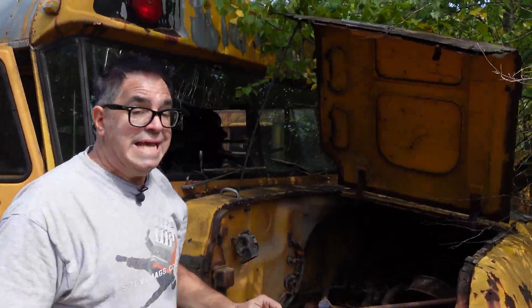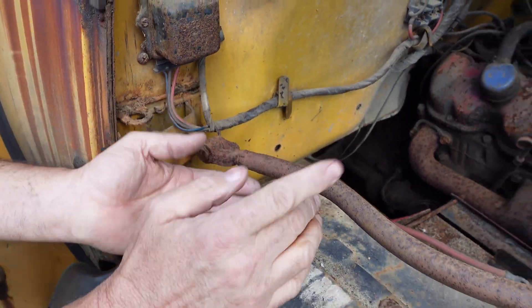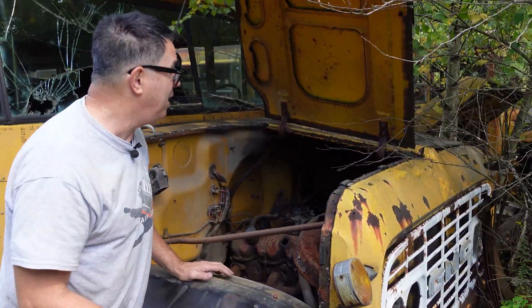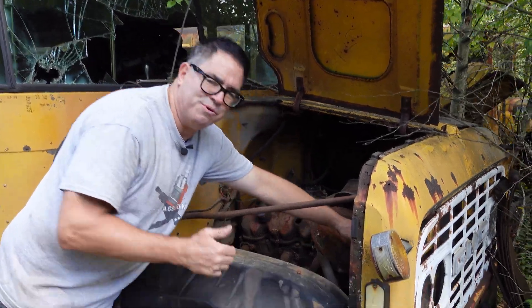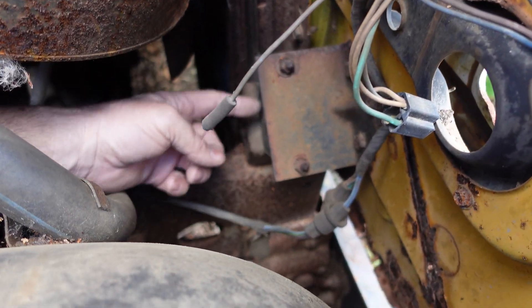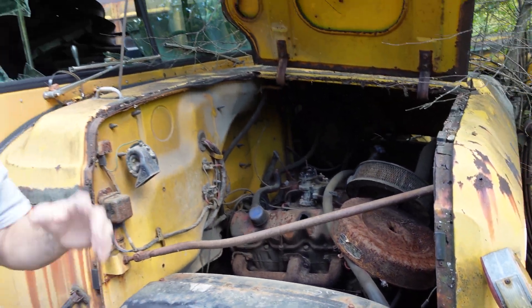This steel clamshell hood is tiltable. These struts right here have a cotter pin with a little clevis. Take the cotter pin out, pull the clevis — this is all rusty, but this would then detach. This clip here would fold down and give you better access. The fenders stayed put — you could unbolt them. Take these two struts out, just a cotter pin and a clevis pin, and this folds down. The hood goes with it and you have pretty much full access to the top of the engine. The hinges are down low in the front, so it's kind of a tilt nose, kind of a clamshell hood. Whatever service needed to be done, you could do it more easily with this design.